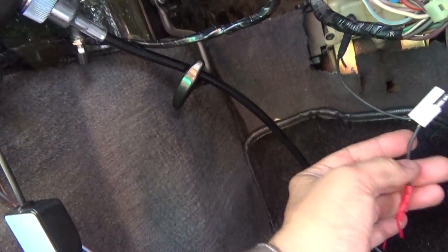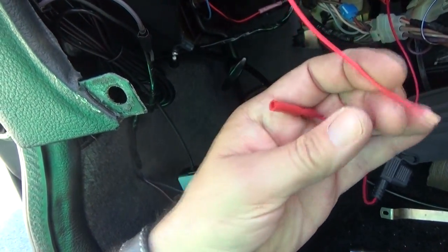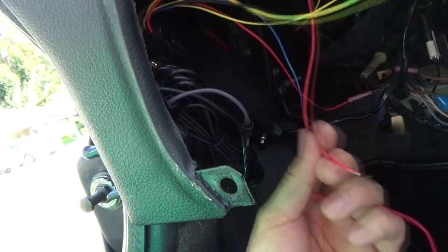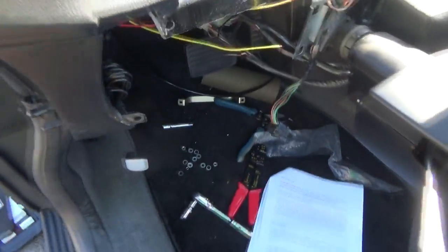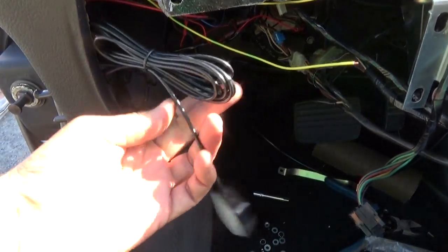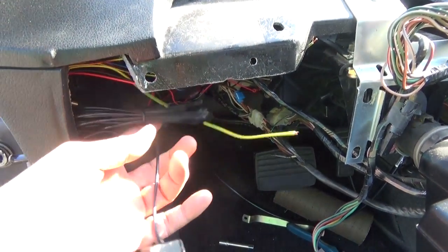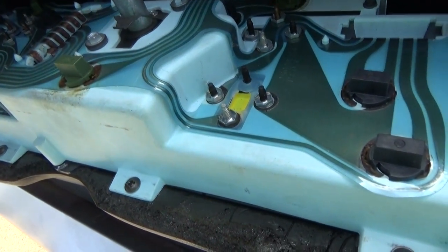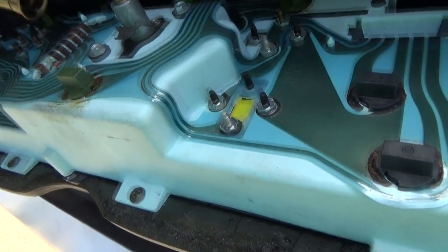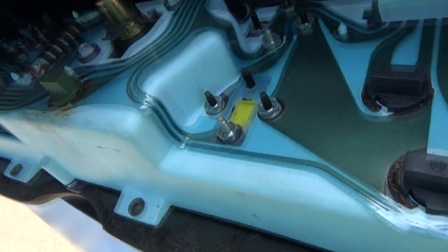Next, we're going to plug the old lambda connector that we've reused for the fuse back into the original lambda harness. Lastly, we're going to make our power connection — the red wire from the unit connected to the fused wire that we connected to the lambda harness. If you've taken your binnacle off like we have, you might want to consider routing the GPS antenna inside before you put the binnacle back on, though this is your preference. When you connect the new speedo cable to the back of the binnacle, it's pretty easy — you just slide it in, push a little clip down, and it holds. That's all you do.